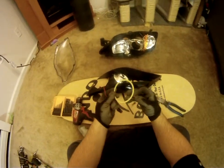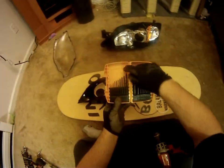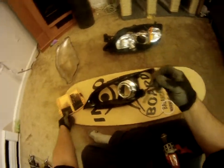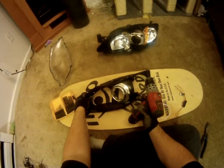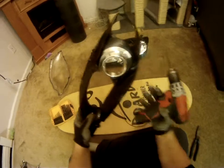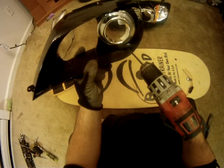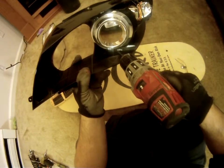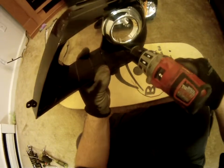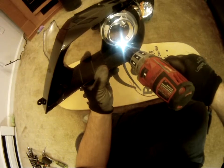This is the XP halo — it comes in the kit that Retrofit Source gives you. You're going to go with a 3/16-inch drill bit. Try to be very, very careful when drilling this hole because the outside can be seen on the outside of your headlights, so you want to center it up as best as possible. Keep your drill head from scratching the bottom of this piece and start real slow.